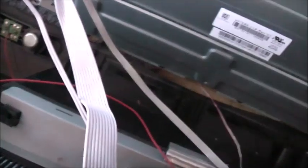If I look this up, I cannot find the AV board for this TV — can't get these AV boards anywhere. So they're kind of screwed, but I could probably just get one of those cheap eBay universal LCD panel drivers. I've got the power supply and the backlight, so I'll find a cheap module off eBay that utilizes this. It'll have AV, VGA, HDMI and everything on it, and this panel just plugs into it. It'll sync with the backlight too. Pretty common on eBay — universal LCD drivers. The T-Con board is alright on this one though.